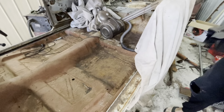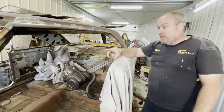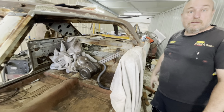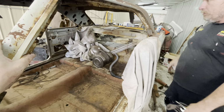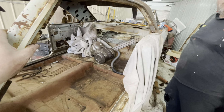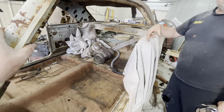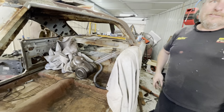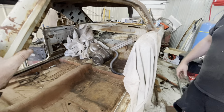And the good thing is, because we're putting a whole floor pan in, it's kind of lucky that we don't have screens in, because you have to put it in through the screen. Oh, no, being hard top, I think you can go in through the door. Through the open aperture. Because I know with sedans, you cannot get a complete floor pan in unless you go through the windscreens. Well, that would make sense because you've got pillars in the way. Exactly.